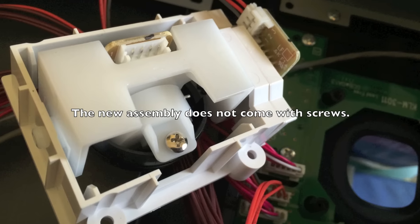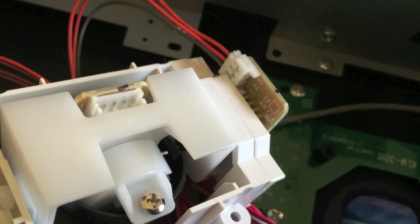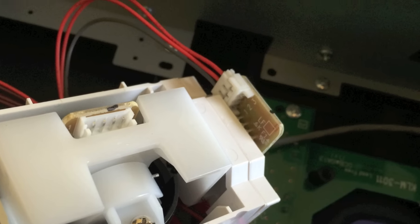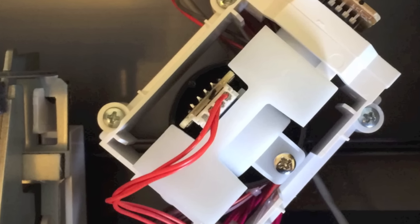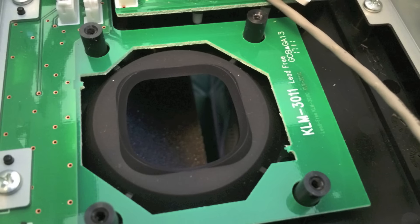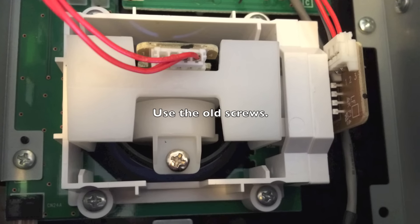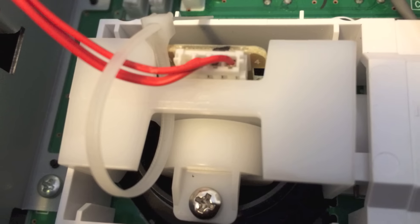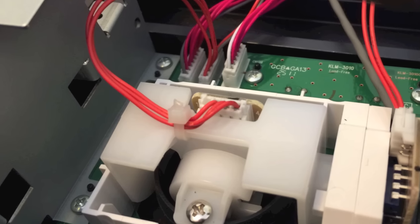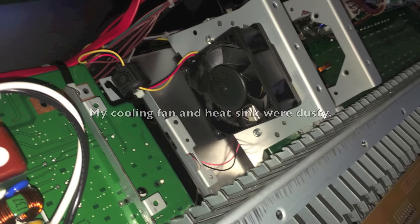Get the new replacement joystick assembly and reattach the side wiring harness to the contact on the joystick, then attach the top wiring harness to the top contact. This is the joystick assembly bed inside the keyboard to which you fasten the new joystick with the four screws. Put a new zip tie through the special hole, tighten it, and then cut off any excess with a snipping tool — and the joystick replacement is done.